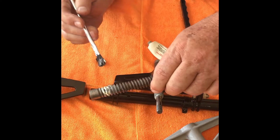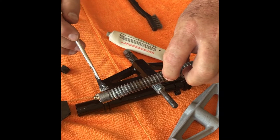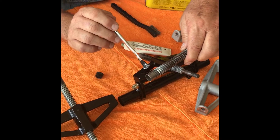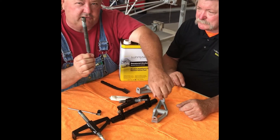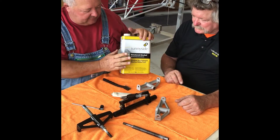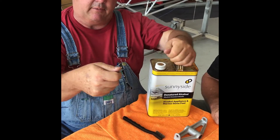Put a nice little coating in there and you're good to go, because you don't want grit in there — that's the big killer of these things. People keep that old grease in there and it attracts grit, which acts like sandpaper on the screw itself and inside the yoke. What we do is take denatured alcohol on a rag and use it like a shoe-shine rag, wrapping it around the jack screw.